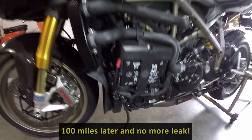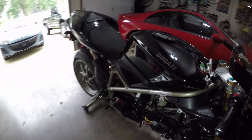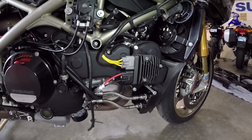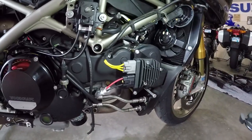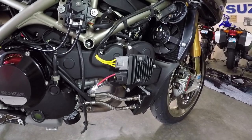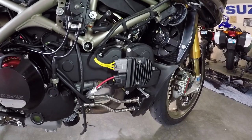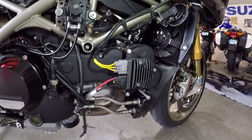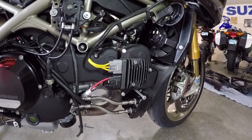So if you're looking to install this new voltage regulator and relocate it to the timing belt cover like I have done, make sure that the stator wires go above and that the connector is above where the wires enter the engine casing on the other side. Just a quick little update to save you a lot of headache — I was riding this bike around, seeing an oil leak, wondering what in the world was going wrong. That was the problem all along. Hope that's helpful, thanks for watching.